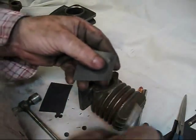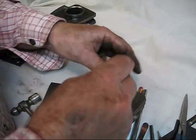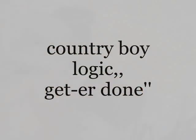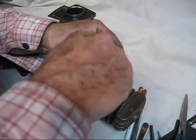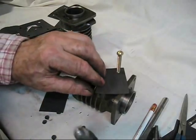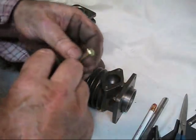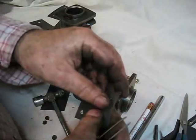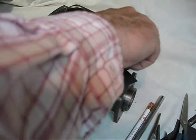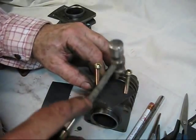See that little imprint there? That's all you need to get that out of there. Now this particular one right here is threaded, and I do want a real good fit. You may wonder how come I'm not using the manifold to make the gasket — well, you see how big that hole is right there? The thread is a 20. So if you make the gasket to fit that right down there, you'll have a better fitting gasket. You put one of them in there to secure the location so you don't have to worry about that one anymore. Now you just go ahead and knock this one out so you will have two holes in the correct position. Now you put this right back on, put that bolt right down in there of the correct size, and that went right down in there. Now that's in perfect alignment. The next thing we need to do is cut the inside of it out, so you just go right around there.